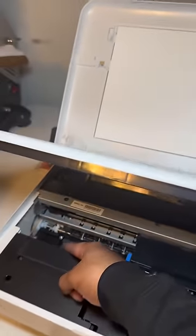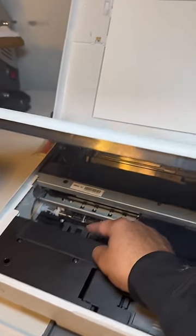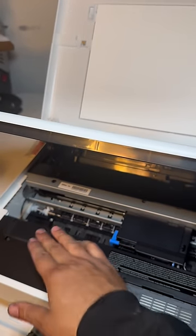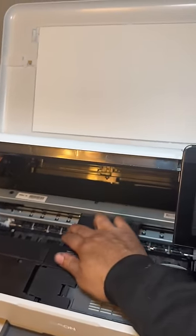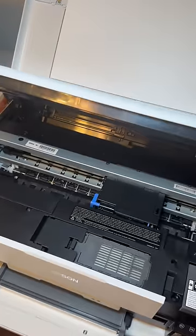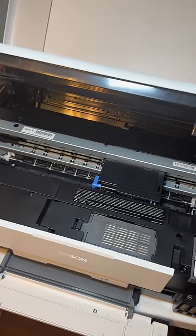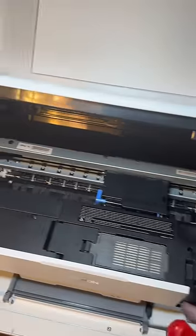On this side is your motherboard, so you always want to stay away from doing any cleanings on this side. I do have additional videos in my ebook around maintenance and how to clean the printhead manually and all that good stuff in case you're running into problems. First we're going to do the rollers before we mess with this, so keep the printhead over to the far side.